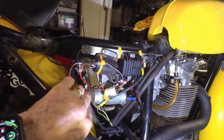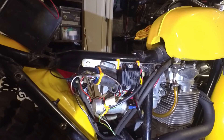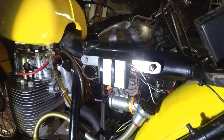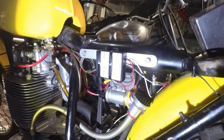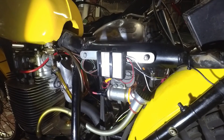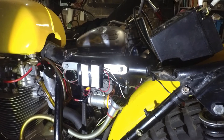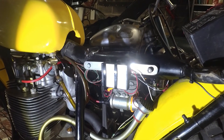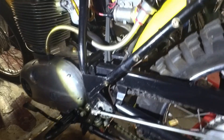The Boyer is attached here and I'm still using the original condenser capacitor just to smooth the DC. It's looking reasonably tidy. The Boyer box is there at the moment - I think I've got a fuse box in order, just two small fuses. I might stick the fuse box up here, though I don't really need it unless I fit a battery. If anything shorts out, it'll just kill the engine anyway. It only becomes a serious fire hazard if there's a battery in the circuit, so I'll maybe fit it or not initially and see how things go without a battery. The brake light switch is wired up, as is the tail light.